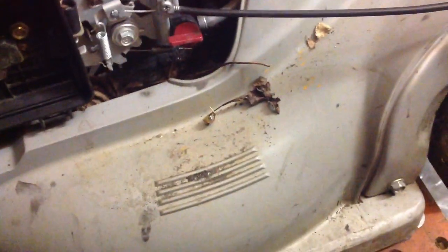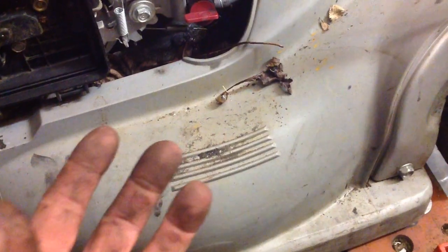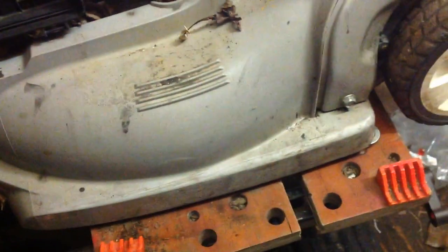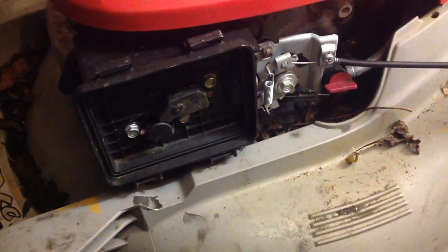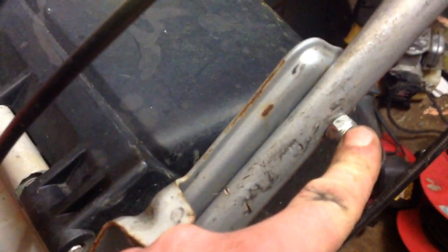This must have been part of the transition from this type of mower to the HRX, because the blade brake is the same as on the HRX. The earlier ones of these had a round piece with two little brake pads — a totally different system — but this one has the better HRX-style blade brake. So they must have changed over during the production run. I've put both handlebars on there; for my dad's use I might just leave them fixed with a nylock nut rather than have them getting loose.